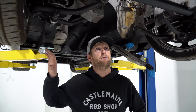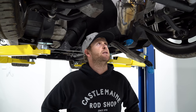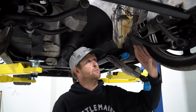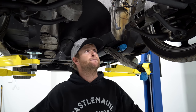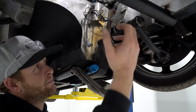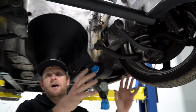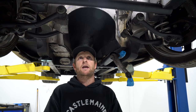We've moved the car from the concrete surface into the air but it probably hasn't gone to plan a hundred percent. That dry sump is still causing a lot of issues, especially on this left hand side. The right hand side is really good but on the left we're still banging into the lower control arm pivot point. So we've made the decision to drop the suspension out and redesign a few things - we're going to remove the lower control arm pin and relocate it, and duplicate that on the other side.